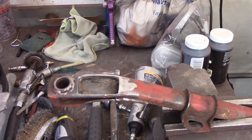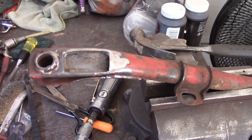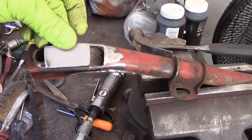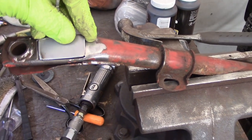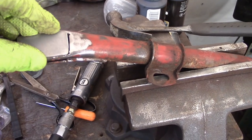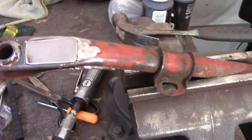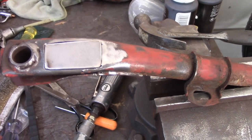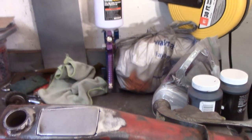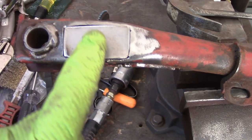All cleaned up — don't have it rust-converted yet. My little patch piece here — that guy will fit in just like that with one hand. A little bit of shaping left to do, especially the corners that start to round a little bit. That's pretty subtle, but I'll do that normal thing where I'll tack it and then pound it flush and weld it up.